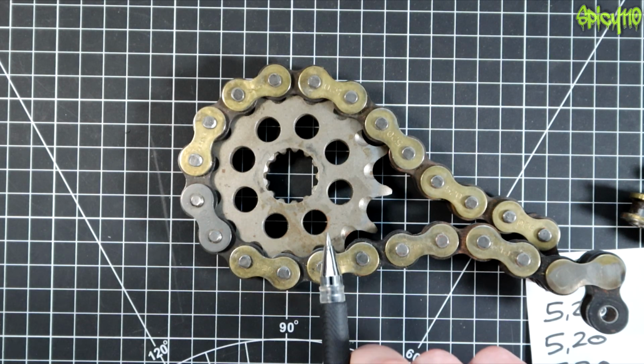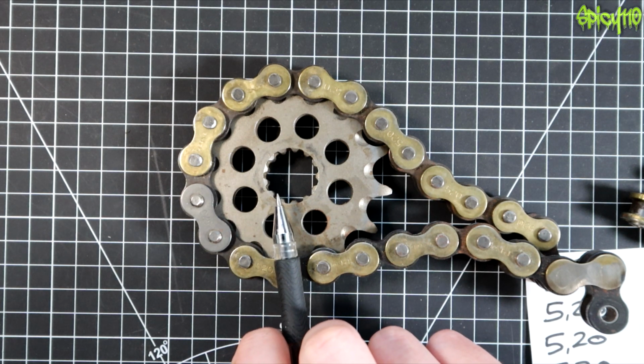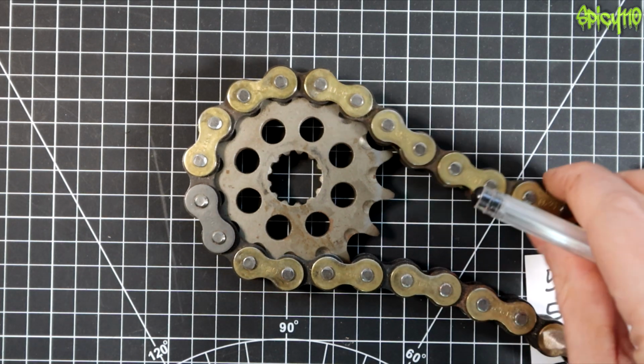Now, as I say, if you get lucky, what's going to happen is your chain's going to get spat out the back of your bike, and you're just going to have to brake and be very careful because you've got no engine braking. So you're free rolling, no power, no engine braking, it's on the brakes alone. And that's a different matter. If you go into neutral and try and brake, it feels quite different. Anyway, that's the best case scenario.